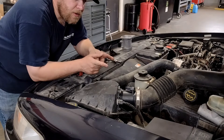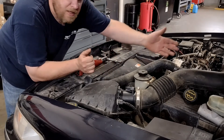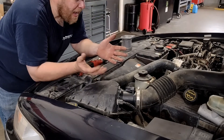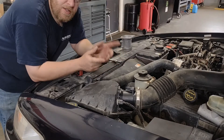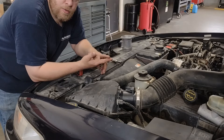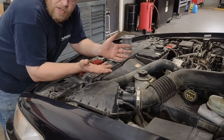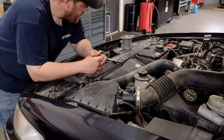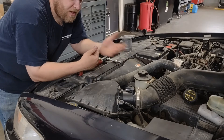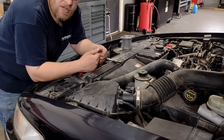With Fords you always want to make sure you reset your fuel and idle adaptive any time you change anything in the system. Ford refers to this as KAM — Keep Alive Memory. The difficult part is that you're going to either need a scan tool capable of resetting this, or you're going to want to do a battery disconnect hard reset to relearn or zero out those memories so the computer can relearn them.